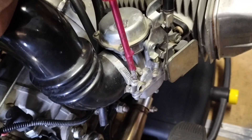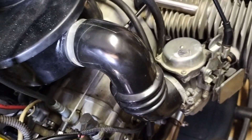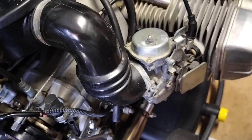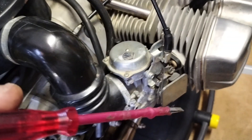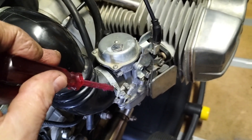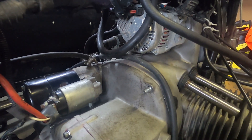Waiting for the bit about the gearbox — he's only taking the sodding battery out anyway. This bit is about the air filter. There's quite a lot of stuff to take off, and the first thing I'm doing is what's called a branch in the parts manual — basically an air duct from the filter box to the carby. Undo it at both ends via the hose clamps at each end, and that gives you a little bit of room to work on getting the air box out.